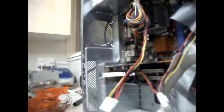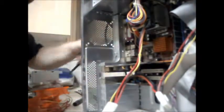So, put the video card in. Take the existing card out. I'll put that up there so I don't get them confused. Now I'm going to put the 512 megabyte card in. I think that's what that means. Yes, 512 meg. I think what I'll do, I'll test both sticks separately. So, we already know this PC works. Better just plug the VGA in and the video card before I forget.